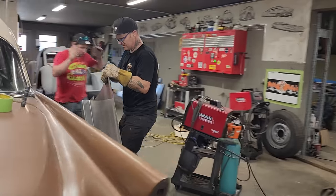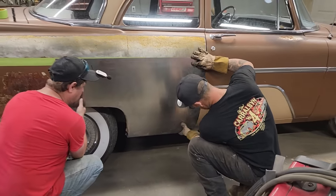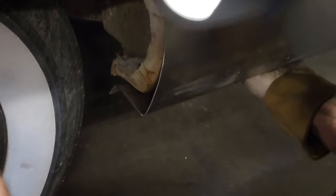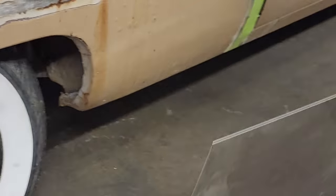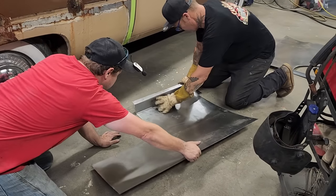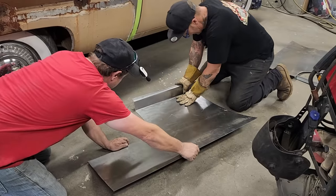You're at the wheel well, Doug. Doug doesn't want gloves on. I'm right on my line, looks good. And I'm pulling that over some to get to. Now, seeing that's too much of a bend we got going on there, that's fine. And we haven't got enough bend, see that right there? It's 18 gauge metal, no harm, no foul. Just want to hold that there, Doug. Just gonna bend it back a little bit. That's nothing. Just lean on it. I'm big, fat, and tough.